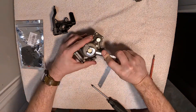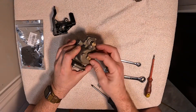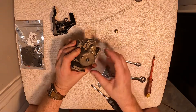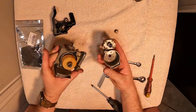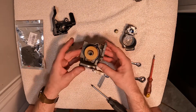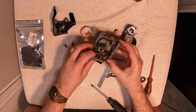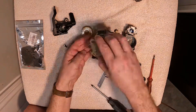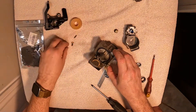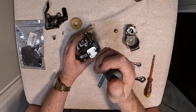13 millimeter for the bowl. There's our main jet. This carb has been cleaned before so there's no cleaning required. Then we have our float — the float just comes out. We can lift up this and the needle is in there, so turn it off, there's our needle, set that aside.